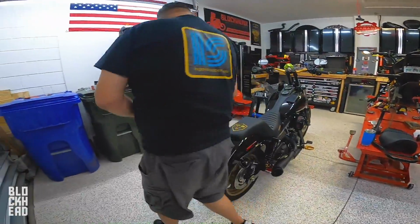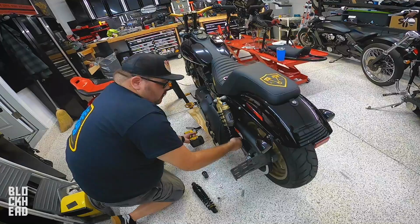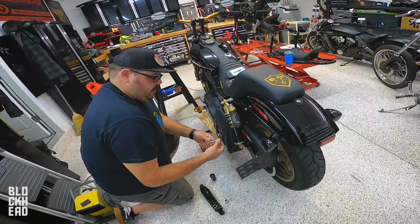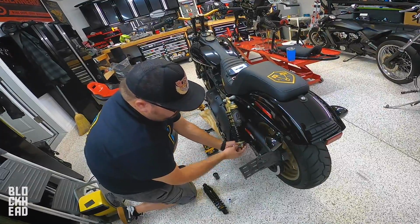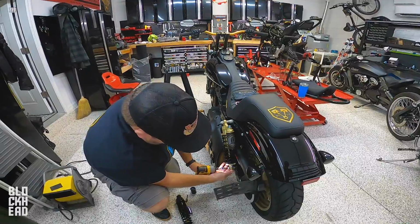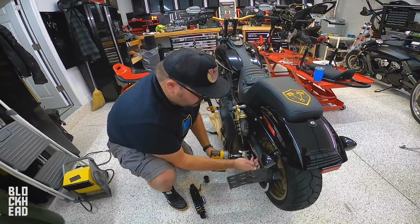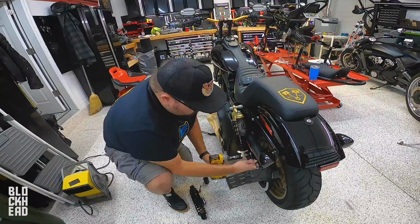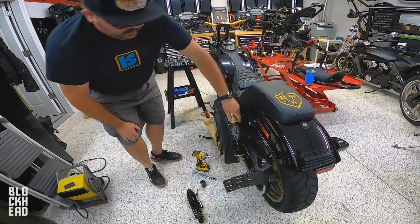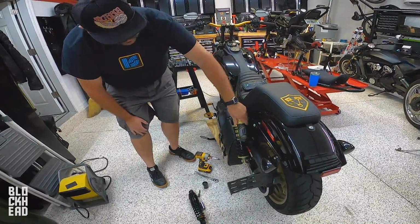Back around here. We got a little tool tower over here. Okay, so you use the factory bolt spacer. It's gonna go through the Heim joint to the other provided spacer. Now the nut back here is a 3/4 inch. Okay, and there you go. See, look at that. You're gonna have that movement right there, but it's not gonna bind up.